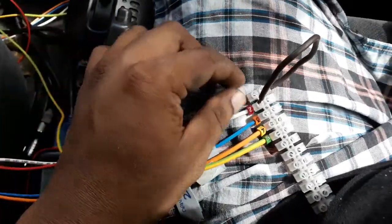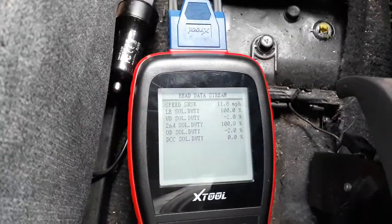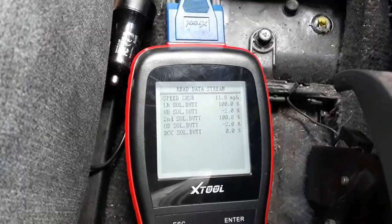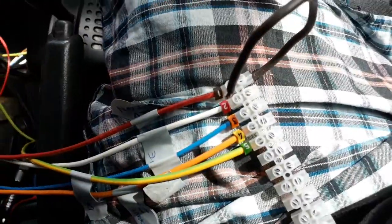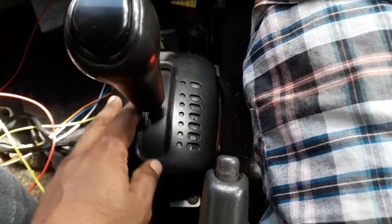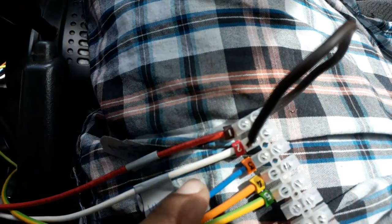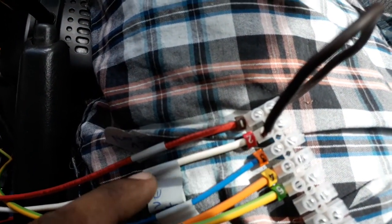And drive one is here. So basically this is my little test unit and I have my tool set up here so I can monitor it. As it stands right now I've already tested it. When you pulse drive — as though you've shifted into drive — this is the original, it hasn't switched over to the tiptronic setup as yet. So as you shift into drive you basically pulse the drive wire number two, as I have it here, and the vehicle will function as normal, as you can see on the dash.